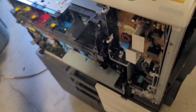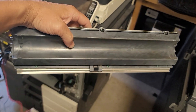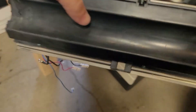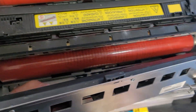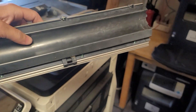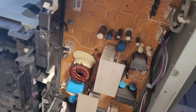It's going to involve this unit here. I've already pulled it out of this one. This is the induction unit — there's a coil in there. You run a little magnetic field and it connects to the fusing unit here and warms up that fusing roller very, very, very hot. Now, we've never seen this go out, but it may have just gone out on one of our customers' machines, but we do not know if it's this or this high voltage unit here.